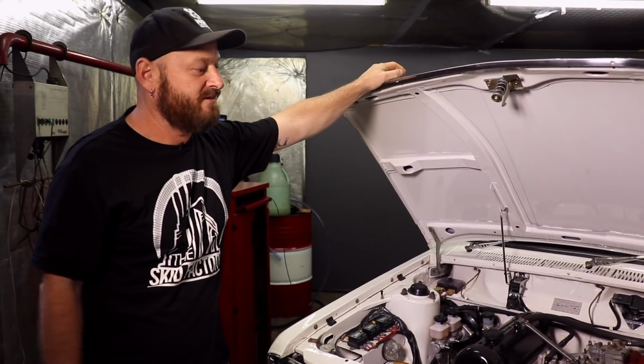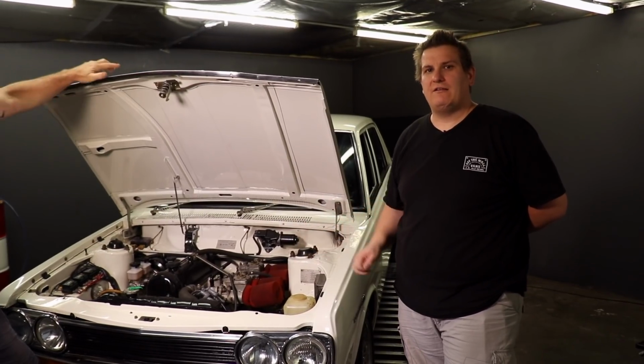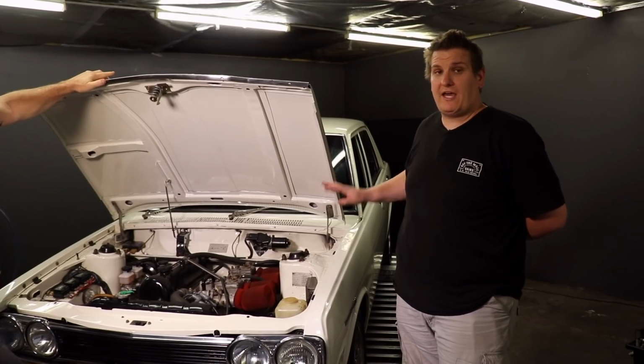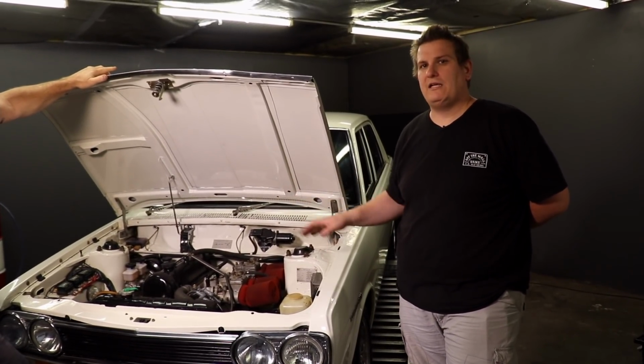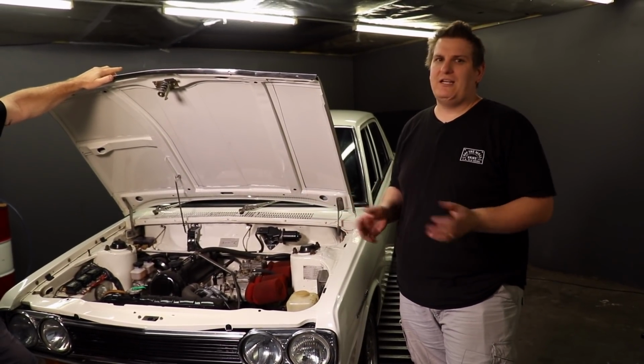whereas a fully programmable ignition system is a big advantage, and Timmy will explain why. Today we're hoping to substitute this distributor for a crank angle sensor. That sensor will feed engine position information to the Haltech computer we're using, which will fire 4 individual coils directly. Using the computer, that allows us to map ignition in an infinite way.